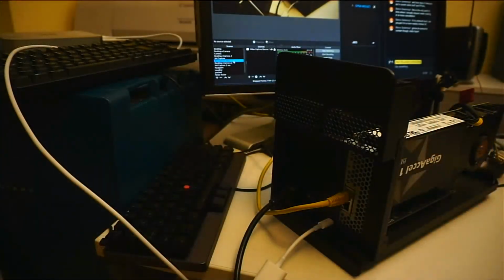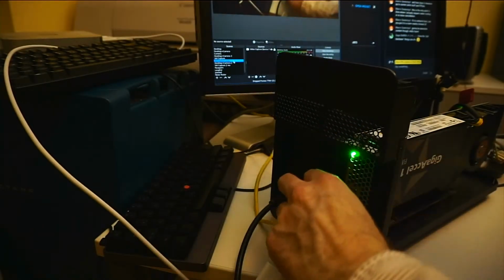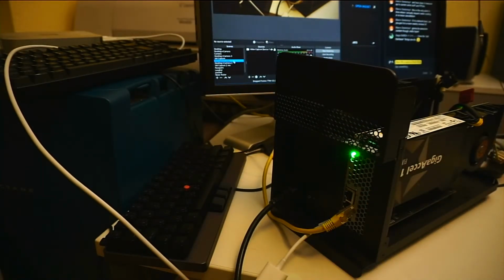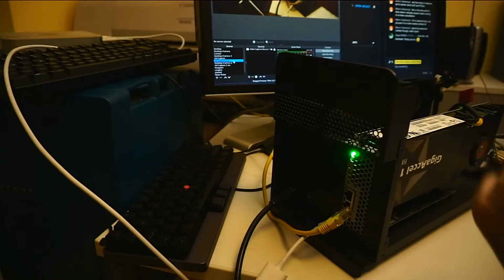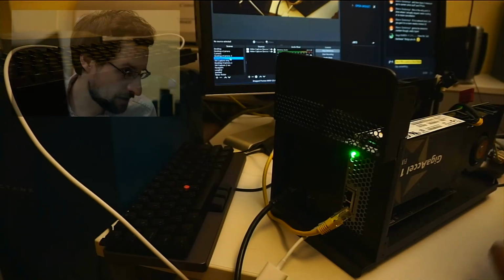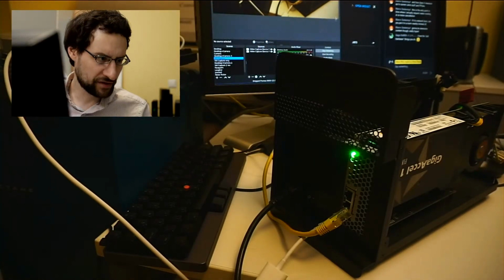Toggling here the power of that one, so that it's on. So I only need to pull the power on the Mac Mini because it is in a special S2 state, and I was debugging this already. So the issue is it doesn't reset. If we suspend to disk and are still on trickle standby power, this card doesn't boot up in the external PCIe thing.